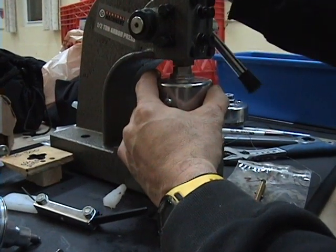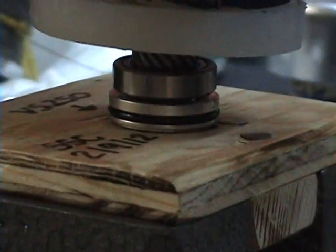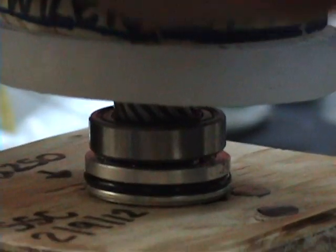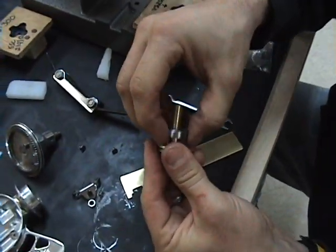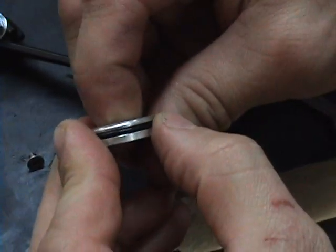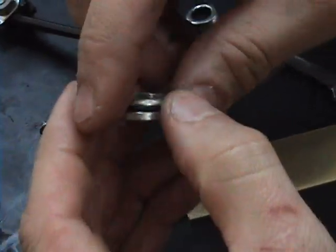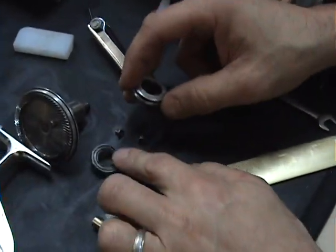We're going to put pressure on the piece so it actually gets into the gear a little bit. And again it's nylon so it's not going to hurt the gear. Then you're going to turn it clockwise and that loosens up your gear so you can take the gear right off. And then here's your bearing. And there is your seal — there are two seals. This seal here stops the water from going up and down, and then there's the outer ring seal which seals this within the cup. That's how you take the seal out.